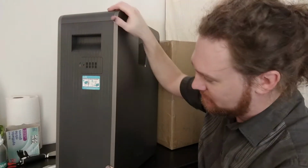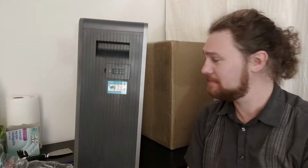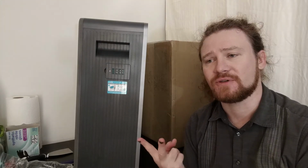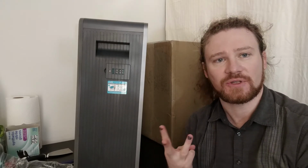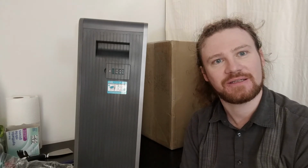So this is sleek looking, and it's the Bissell Air 400. It's supposed to be able to purify a 400 square foot living space, I think once an hour, which seems absurd. But it's a 3-level filtration. There's a pre-filter to pull out large dust particles, then a carbon filter to pull out volatile organic compounds, which the printer is going to kick out, and then a HEPA filter to pull out allergens, microbes, fur, dander, tiny particles down to something ridiculously small.